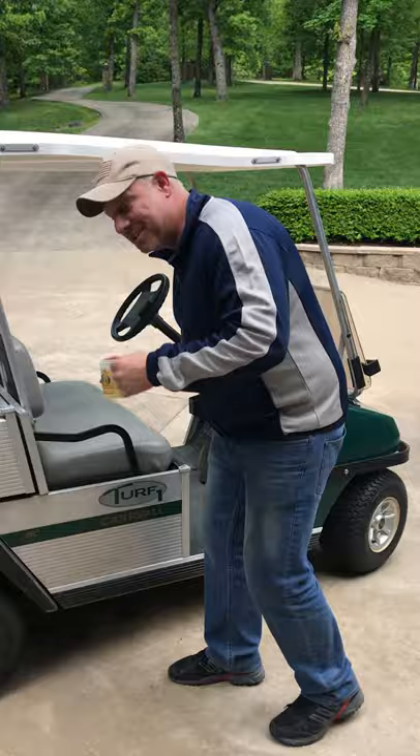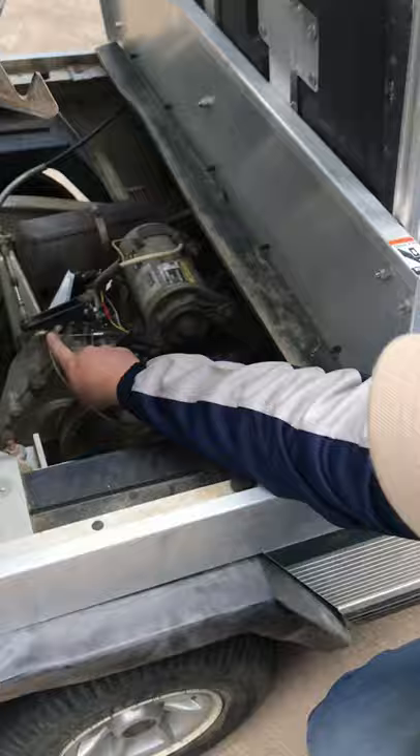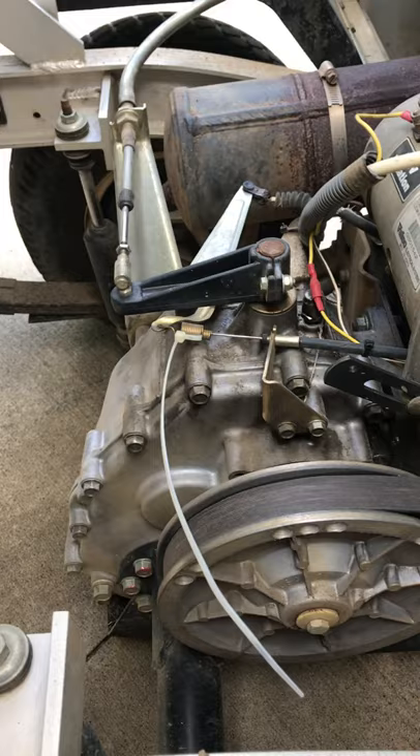You don't have to take the seat off. Right back around here, come right back over here — right here, there's a spring. That's the governor. If you don't know where it is, just keep looking; step on the gas pedal and it'll move. All you have to do is put a zip tie through that spring and pull it tight. As my girlfriend figured out, that's it — and you're hauling ass. Don't blow up your engine. See ya.